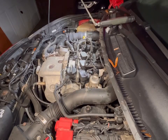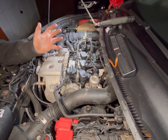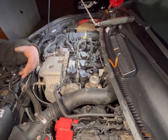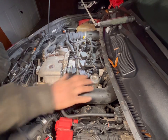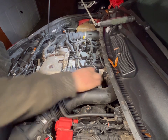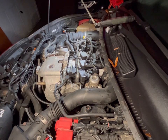Right, folks, so you join me at the top of the engine, and what we're going to be starting off by doing is removing all the top components to get the rocker cover off so we can actually work through it properly. We'll have to take all the heat shields off to get the cat out of the way. But yeah, we'll start off all the way up here. So airbox removal first off: clip out, then the plug off. 7mm Jubilees at each side of there, and then pop that off and get her out that way. So yeah, we'll make a start on her.